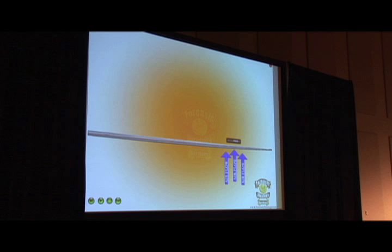Today almost all platters are made with aluminum or glass. Glass has some advantages — it's smoother than aluminum, doesn't expand as much when heated, and because the same weight of glass is more rigid than aluminum, they can make the platters thinner. Thinner platters weigh less and can spin faster. Over the years, this has increased the speed at which we can read data from the hard drive.